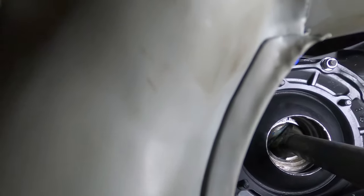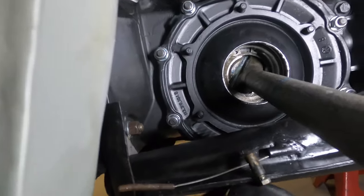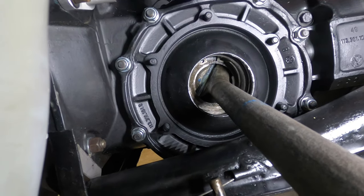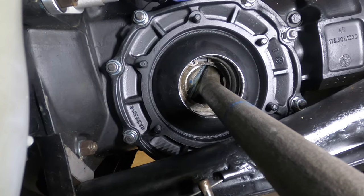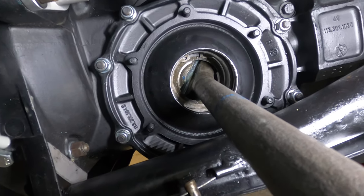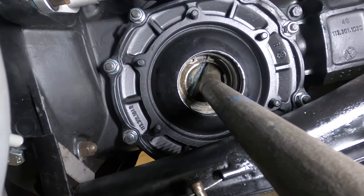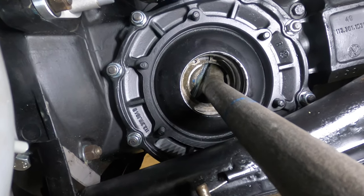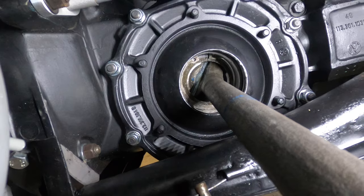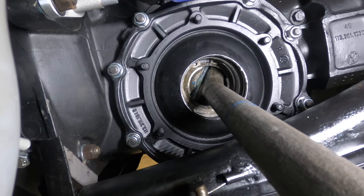The ring's in there, the axle's not coming out. Now we're going to put this little piece on and then put the axle tube on top of it. When we do that, snug up the nuts for the axle tube portion. You want a little bit of resistance when moving up and down — not too much. You can get more resistance by using fewer gaskets and less resistance by using more gaskets. I'd definitely suggest buying more gaskets than you need — maybe two gasket kits.